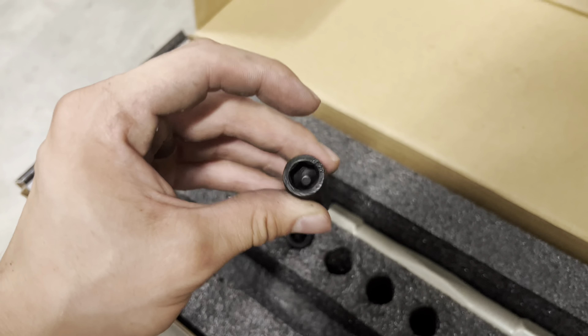We'll start the other side and then get the rear started, and once everything's all done we'll make our full adjustments. Now we got both sides off. Before you put in your new one, make sure you have it preset at the same length as the OEM one — basically measure from the center to the end and adjust so it matches.